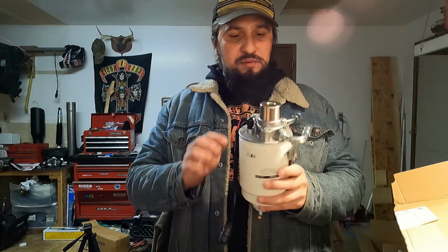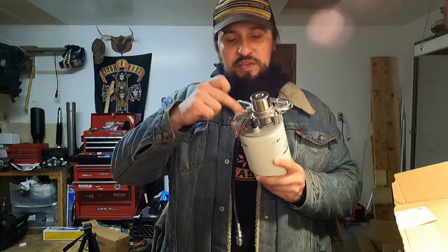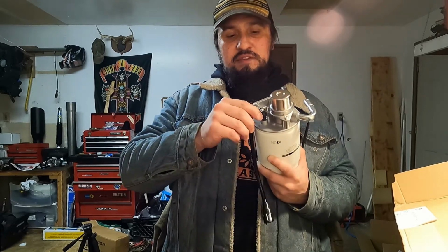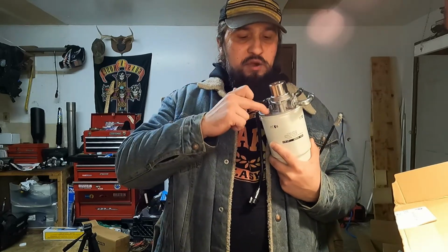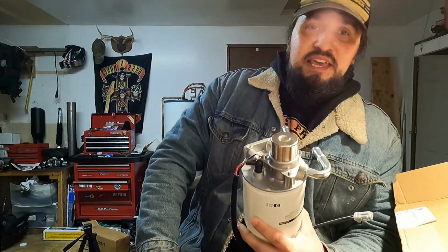So, let's go over why I'm doing this, because the fans of the channel know that I just recently rebuilt my old housing and put that back in after it not being in my truck for about 2 years. Well, when I put the old one back in, I found that the fuel heater, which is the whole reason why I put it back in the first place, doesn't work. It's dead as a doornail. Even though I put a test light on the electrical connection itself, and I confirmed that there is power going to the fuel heater itself. The fuel heater just is not producing any heat.